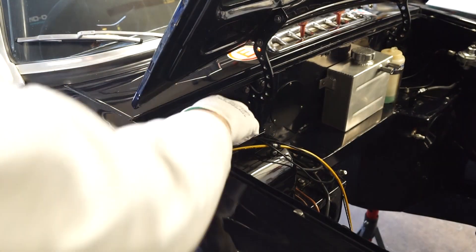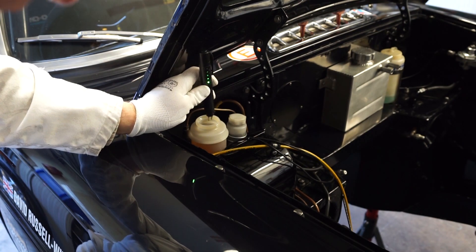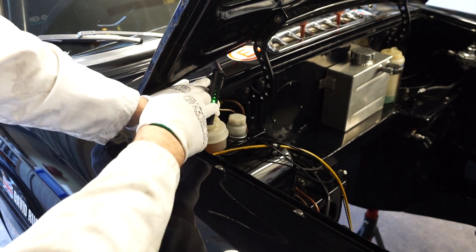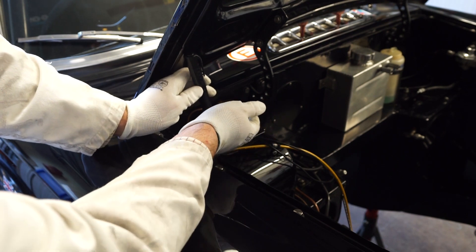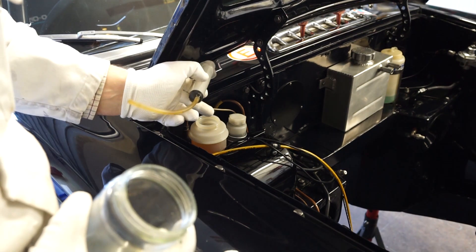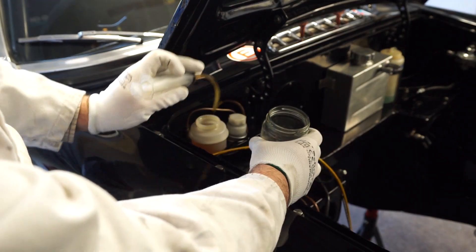It's a good opportunity now to use our little brake fluid tester. I'm just going to take the top off the master cylinder — be very careful not to spill any fluid on the bodywork. The tester just has a green light and it will change colour if there's water in the fluid. This fluid is fairly new and you can see it stayed at 0%, which is just what we want to see. If you are seeing two or three percent water in the fluid, it is worth using a syringe to drain some of it out first before you start flushing through, so you're not introducing contaminated fluid with the new stuff. A little syringe in the top and you can just suck it out and put it into a jar.